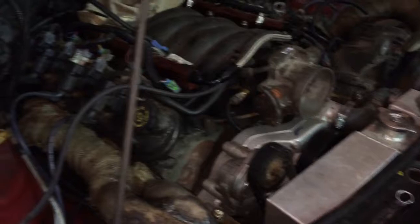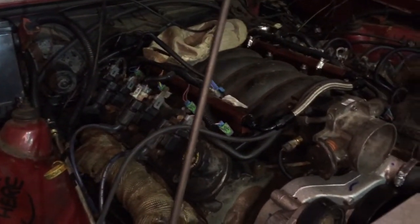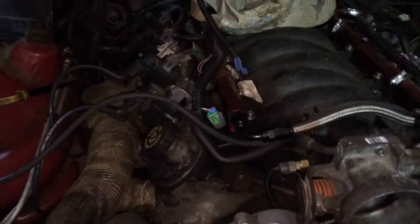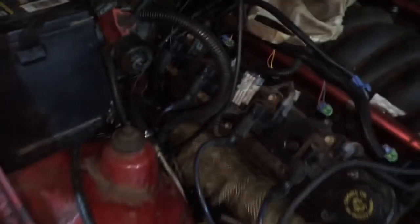It's not running — I mean it could fire, I just don't have gas in it. I figured I'd get some stuff explained before I fired it because I'll never remember. You can see the G6 coils fit in there — I actually shortened all of them and they're still too long. And I got the manifold heat wrap.